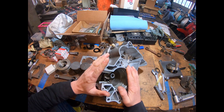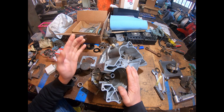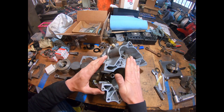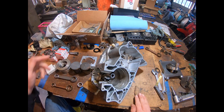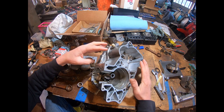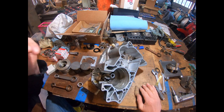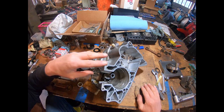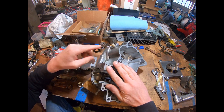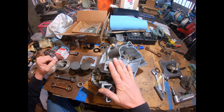This is a 1974 Yamaha RD200 — it's a parallel twin but split vertically, as opposed to horizontally like all the larger ones. Our job was to tune it for Formula 125 racing. The RD200 is actually allowed as long as you have smaller carbs — 22mm is the maximum.